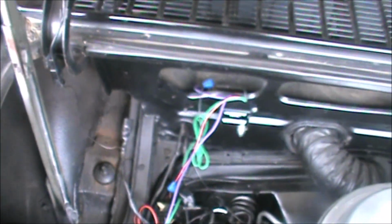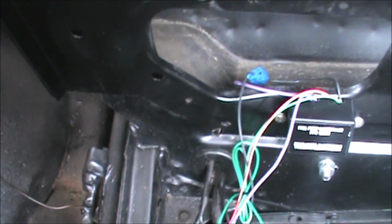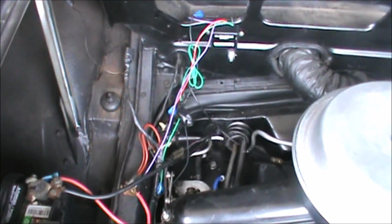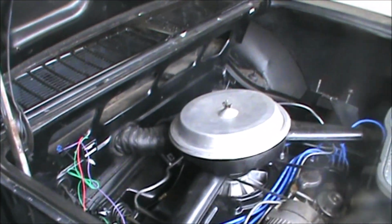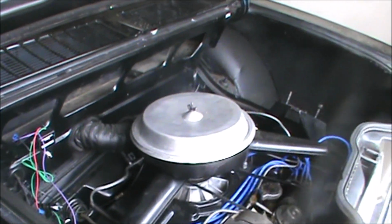Here we are, day 3. Never did find my electrical tape, but I didn't need it. This is the ground from the pump. Managed to reach up, and I just connected it to the ground to the fuel pump controller with a tap splice. Put the positive terminal back on, and I have primed the carburetors to hopefully give the engine the best chance of running. Let's get these sockets out of here, make sure there are no other tools in the engine bay. And guys, I think it's moment of truth time. Let's get in, turn the key, and see what happens.